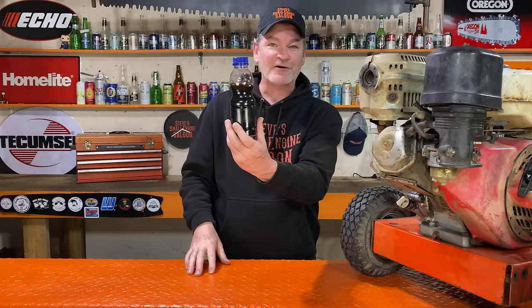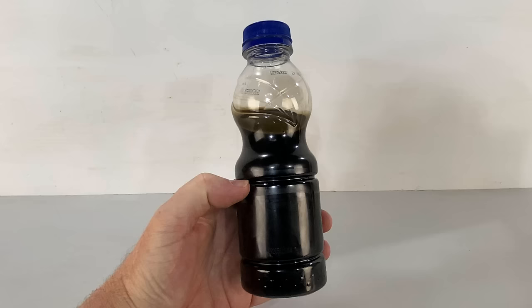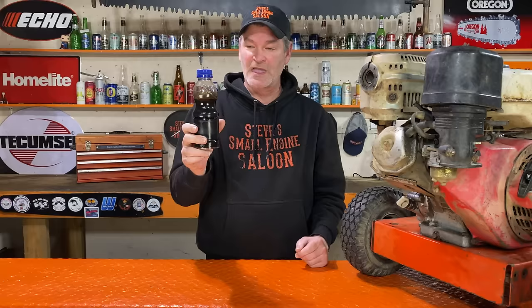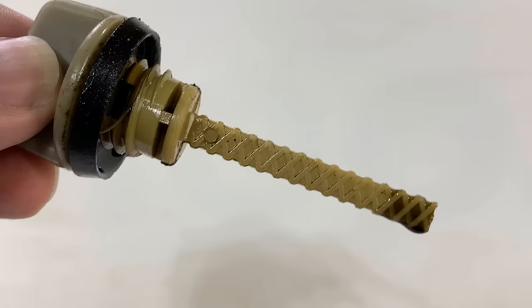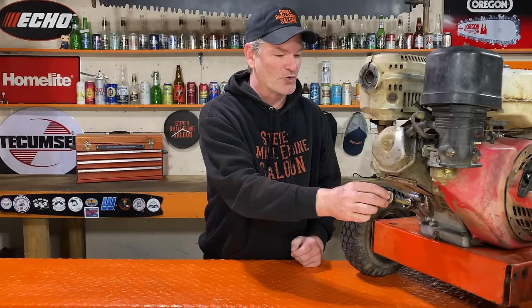This engine right here had this much oil in it. That is a 500 milliliter bottle and you can see it's down that far — I'll call that 350, maybe 400 milliliters of oil. That's every drop I could get out of this engine. This engine should have had three times that amount — three of these bottles — but because there was a little bit on the end of the dipstick, the person thought it was in the safe zone with enough oil. Not even close, and this engine is now completely destroyed.